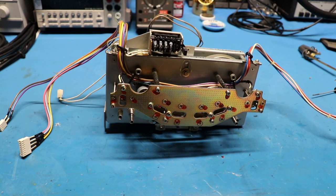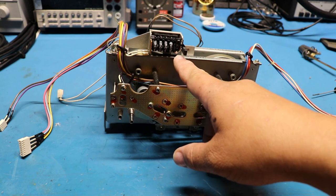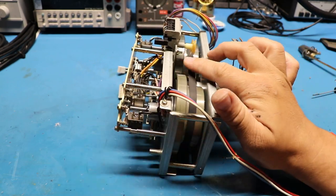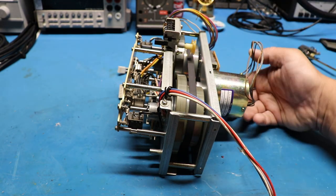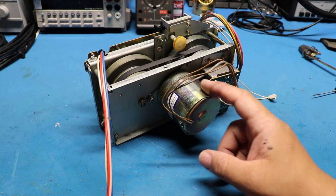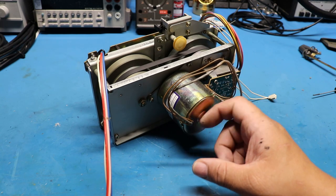Finished reassembling the transport - went ahead and put the head block back on and re-oiled the counter shaft. It's very important that you clean the old oil off the shaft and put a drop of oil back on it, because otherwise in rewind and forward you'll get a loud grinding sound and think the bearings are bad. One note: on these particular counters there is a little foam washer that spaces the pulley from the plastic - make sure you don't lose it and put it back on correctly, otherwise it won't line up with the pulley on top. As for rebuilding the motor, the motor is in two cases with a rubber inside that dampens vibration.